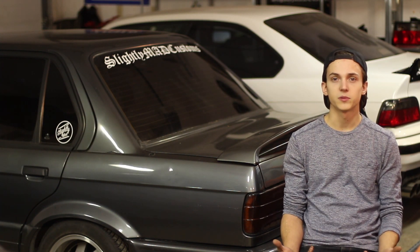The issue with the M5X intake manifolds is they're bigger and bulkier and they get in the way of your stock brake booster location. Some people recommend finding a brake booster from a different vehicle, but after reading through the forums I've heard lots of people complaining about a worse or just a different sort of brake feel. So for my swap I decided to just move the brake booster half an inch and keep the stock brake feel and do it for cheap.